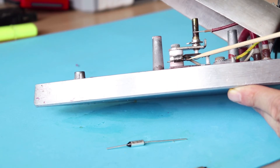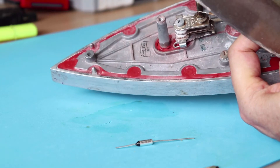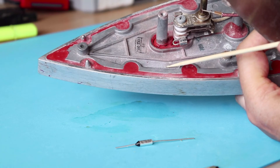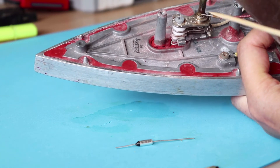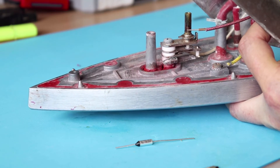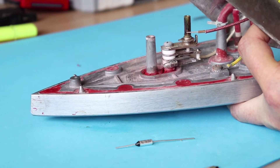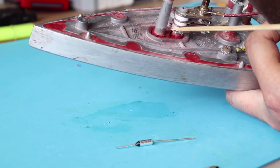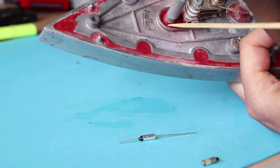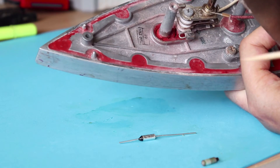What I was advised to do is to run a piece of very fine sandpaper and polish those two plates a little bit. You also have to check if there are any cracks in the red silicon, which is a seal that prevents vapor coming up from the plate that heats the water. As you can see here, I have a few cracks that may have caused very hot vapor to leak out and break my fuse.